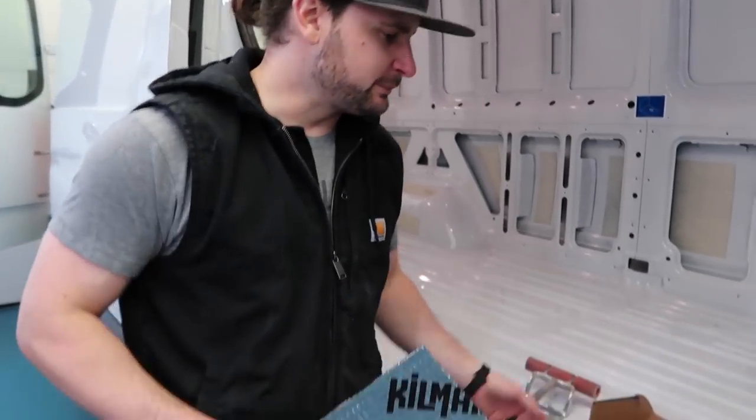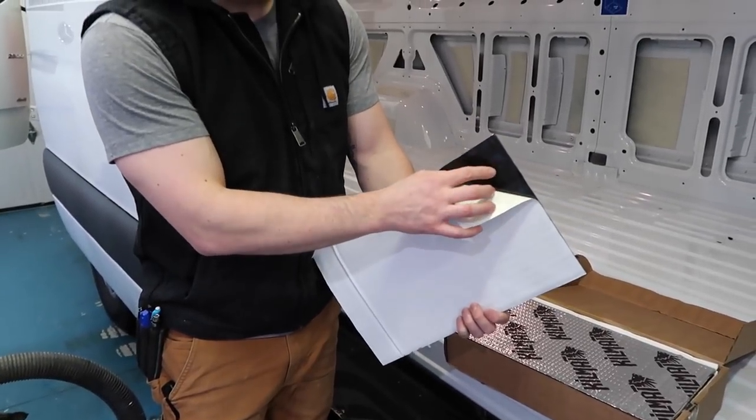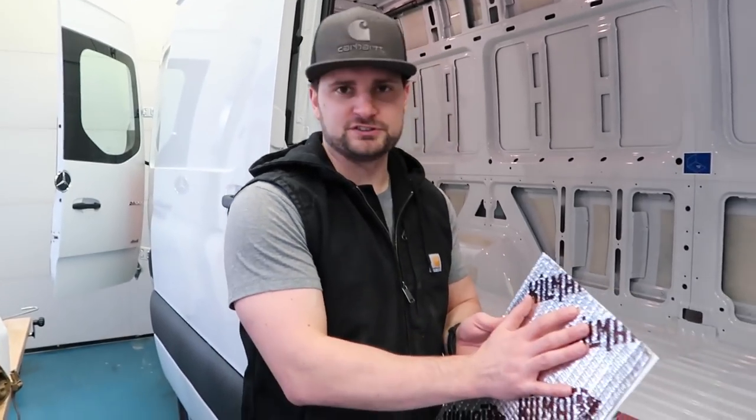So kill mat — we ordered three boxes. It comes in a heavy duty box and they tell you how many square feet are in each box. It has this reflective side on one side, and the other side is like a black sticky tar type material. Ori is going to go through and lay this on the entire metal floor. We did pull out the stock subfloor. I would recommend if you are ordering a van from Mercedes that you do get it with the wooden stock floor — it's engineered for these vans, it's going to fit perfectly and give you the best base for building your van. So we're going to put this down, then do a little bit of foam insulation over top, then put the subfloor back down and start to build out the van on top of the subfloor.